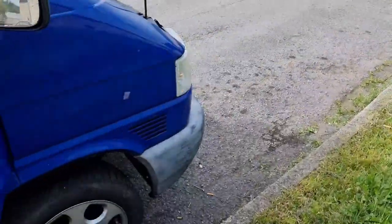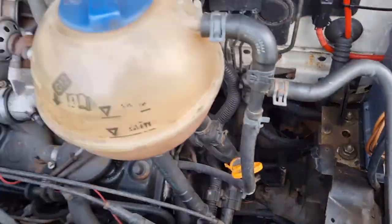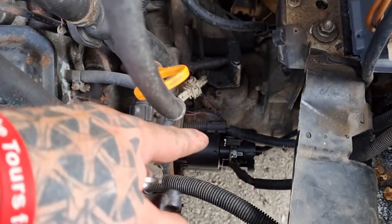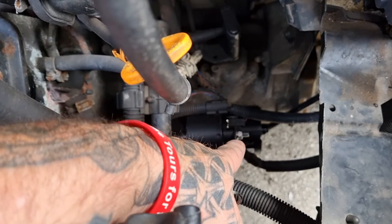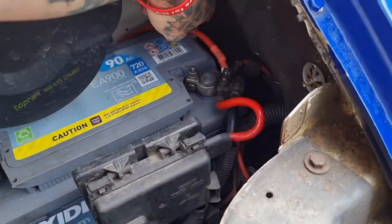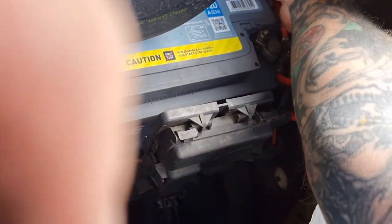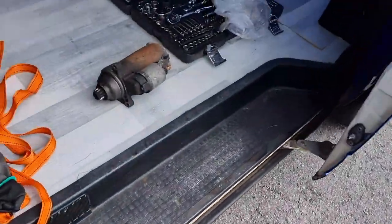That's it — there's three Allen head bolts. It's situated on the right-hand side as you look at the engine. Go to your water bottle, follow it down, and it'll be directly below the water bottle. This is a 1.9 turbo diesel but they're all in the same place. You've got the power cable coming in — take that nut off, unclip your spade — but do your battery first, just to make sure nothing's going to short or touch a socket or spanner.